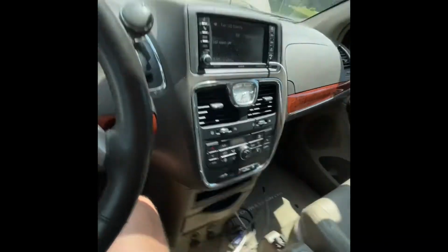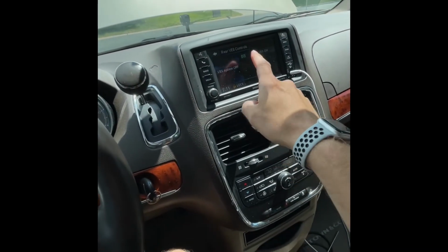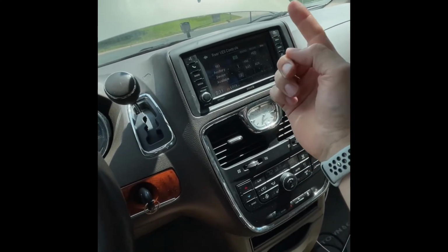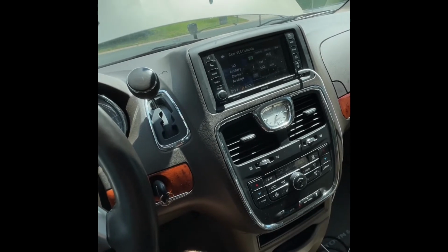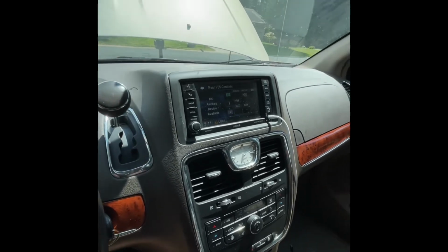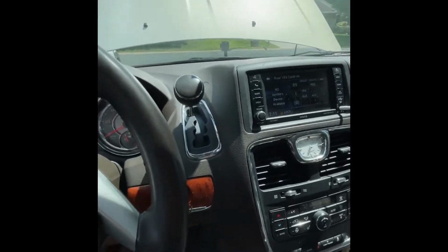So all of a sudden now, the garage door light would work. The vanity light, that thing works. For some reason, that's all tied in, including your rear TV screen now. So I changed the fuse, everything started working. I thought, great, I was able to run the TV in the back, and then it popped again. And after a while I realized it was when I put the van into reverse that popped the fuse. So we started doing a little digging on that. I'm going to shut her off here. Well, I'm going to be able to see that the DVD player's working.